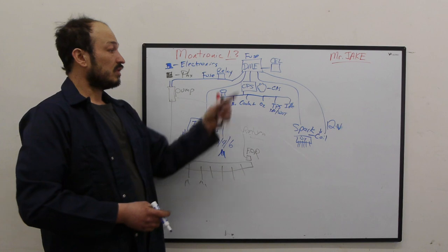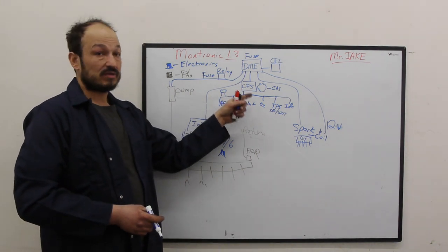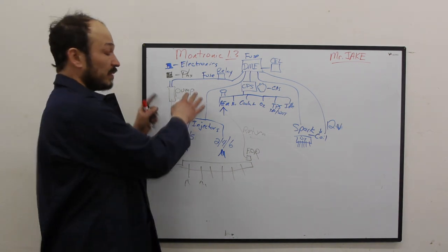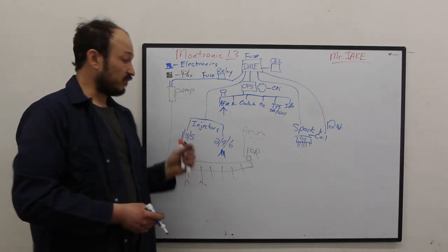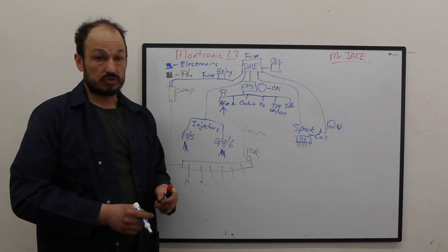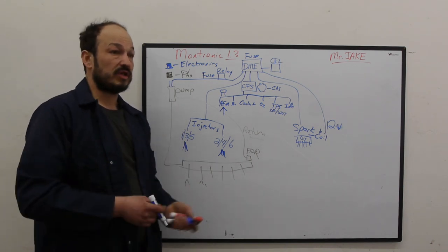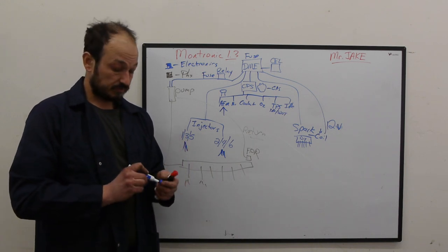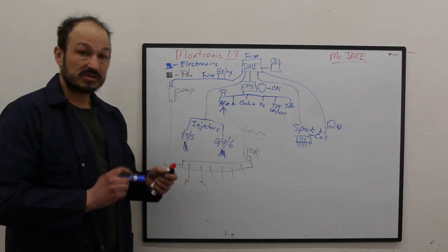The thing won't know that it's cranking or spinning to turn the fuel pump relay on to turn the fuel pump on. Also, if your fuel pump doesn't work, if it's bad, if you have no fuel pressure, that's gonna be an issue too. So again, go back to that last video and you'll see it running and us play with things and adjust things, okay? Questions?